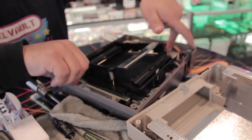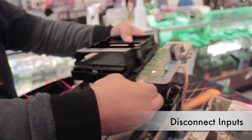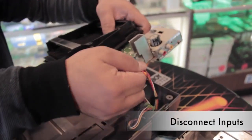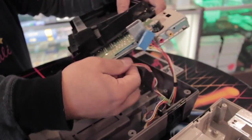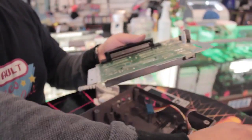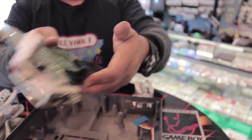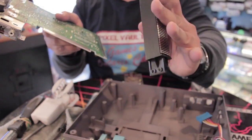Now everything should be loose. First thing I do is take everything off — the controller ports, take the whole power strip off right there. Don't be scared of opening this up. One of the things is do not be scared — it's very primitive. Put this aside, and now the bottom keys, take this off. This right here, the pin connector — take that off. We'll get to this one in a minute.